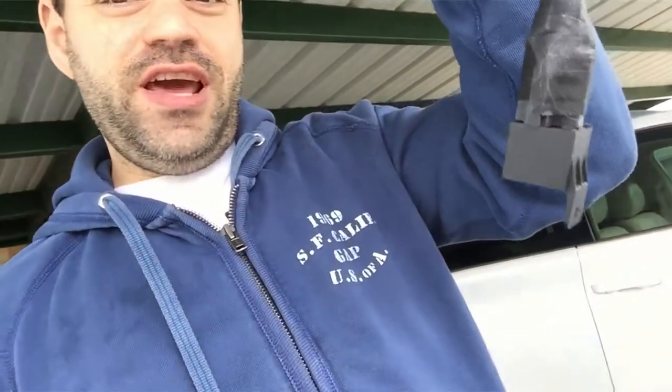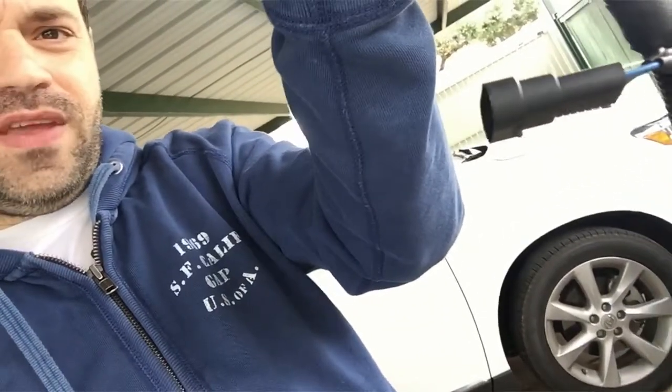I contacted eBay people, and of course just asked for their help. I wasn't complaining yet, and so I thought, okay, let me plug straight into the battery. It worked. So I realized that it needed a little more. So that's a 5-minute job, right? What I did here was, you can see there's a relay, which means this is the trigger, right? So I'll plug the light that comes from the headlight into this, which is going to trigger my relay and get the power straight from the battery.